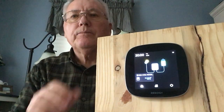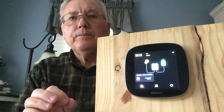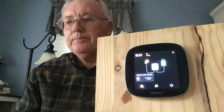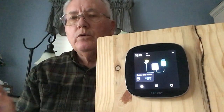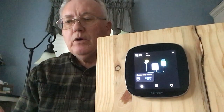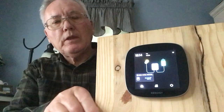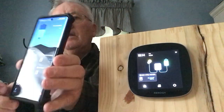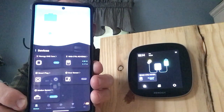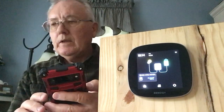Once that is done, you can set up your automation products. Be sure that the first thing you do is have the DC Home app on your phone and find the core with the DC Home app. After that, you can take your motion sensor, window and door sensor, and smart plug and tie those devices in with the core for automation. Your screen would then look something like this, showing the sensors, the smart plug, your system, and the core.